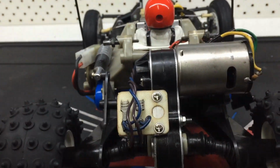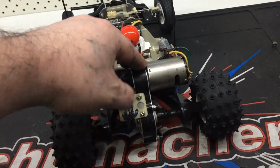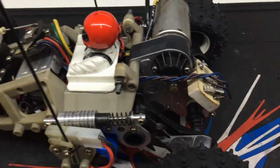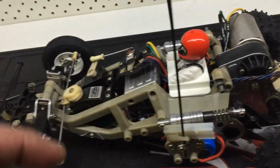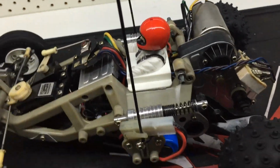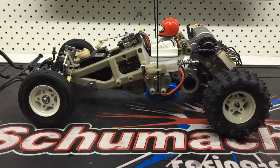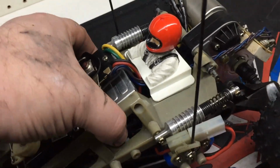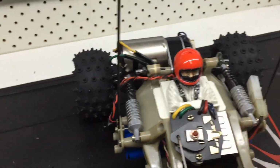And to make the shafts a little bit straighter on the back, try and get the ride height down a little bit, I took the little spacers out of the shocks, so it's a little bit softer. I changed the oil in the shocks and also put a little 3mm spacer in each one just to keep it a bit lower. Where I'm going to drive it, it doesn't need to be up in the air anyway. So hopefully it'll save the gearbox and the drive shaft a little bit longer.